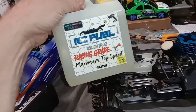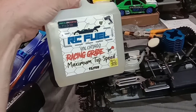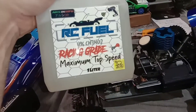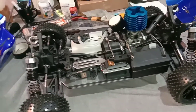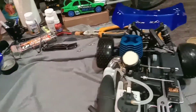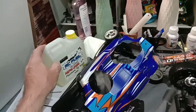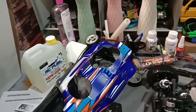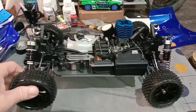I got some good fuel on the way. I tried 0% nitro in my old HPI but it doesn't start good and it did not idle good — when it was running it ran pretty good, but I ordered some more expensive 16% nitro, so we'll try that. These are expensive to maintain — a gallon of fuel is like $40 US dollars. You could buy a really good LiPo battery for $40 and it'll last you a long time.